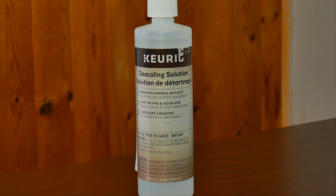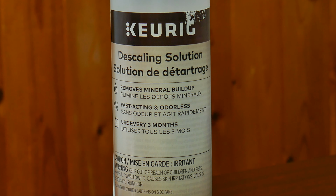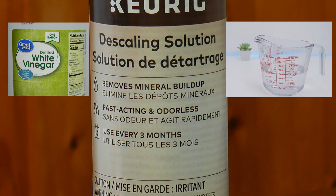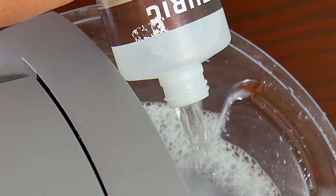And for this, you can use the Keurig descaling solution. We'll leave links in the description, or you can make your own magic potion by using 50% distilled white vinegar and 50% filtered water. If you have any water in the Keurig reservoir, we want to remove it and add the entire contents of the bottle in it.